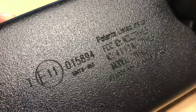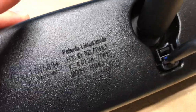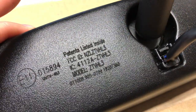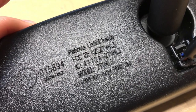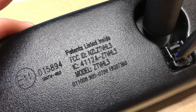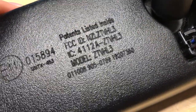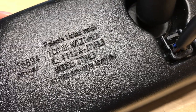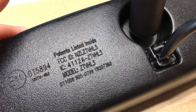On the back of it you can see the GNTX 453 number right here — that's the Gentex model number. You'll see some other FCC IDs and model IDs. I believe the full number means the auto-dimming version with HomeLink. You'll find those part numbers on different vehicle models. The numbers at the bottom are actually the part numbers the car manufacturer uses for their own identification.